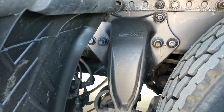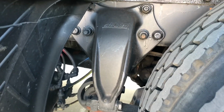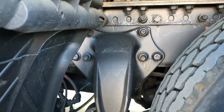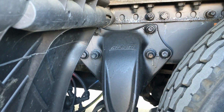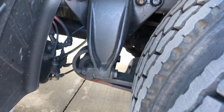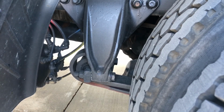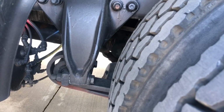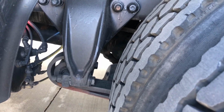All right, we're going to now come down to our suspension here on the second axle. Here again, we're going to have some spring mounts, making sure that those are bolted firmly to the frame. There's no excessive rust. We're checking the spring mounts the same way we checked on the front. A part that's different back here on suspension is a torque spring, making sure the torque spring is not bent, cracked, or broken, and it is working properly as well. From the torque spring, it's difficult to see from here, but over there we have U-bolts, and those are checked the same as the front.